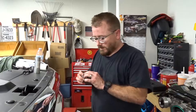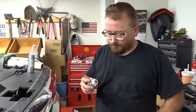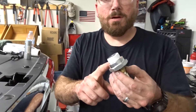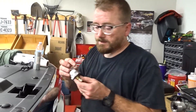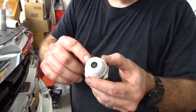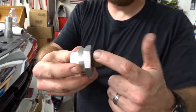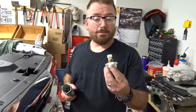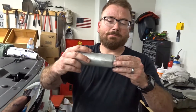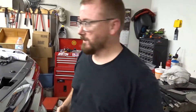Now that I'm covered in coolant — that was awesome. Here's our adapter right here, here's our coolant temp sensor. The adapter is going in the block, and then this washer will go on it like that. I went ahead and wrapped Teflon tape around the coolant temp sensor before I put it in, and I'll put it around this piece too. I don't have a socket or an adjustable wrench that'll fit this, but I happen to remember I have a water heater element wrench — perfect fit, that's what I'm gonna use.